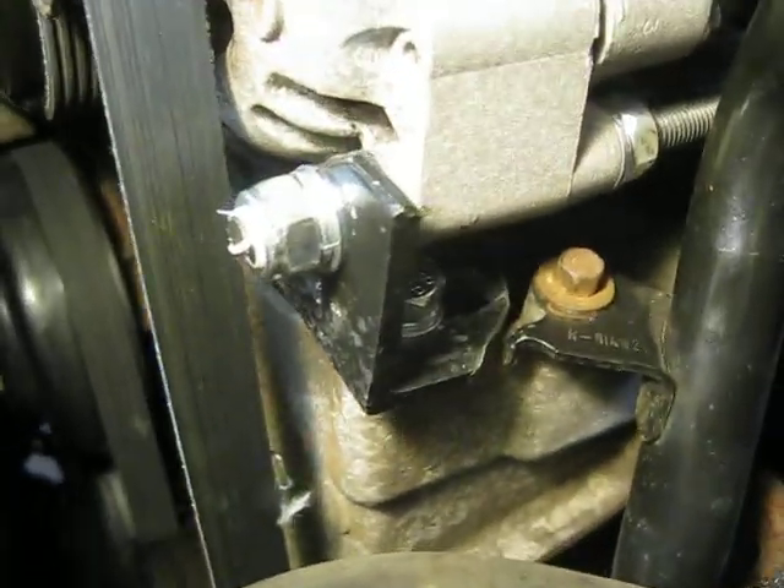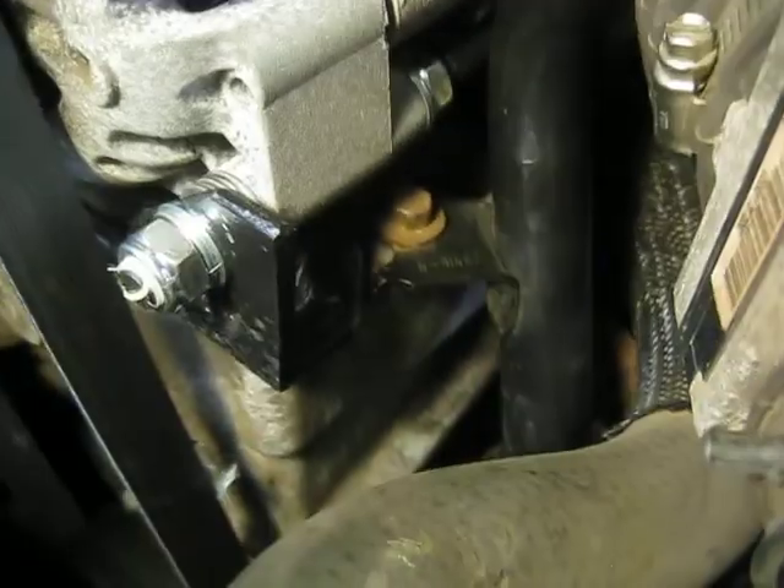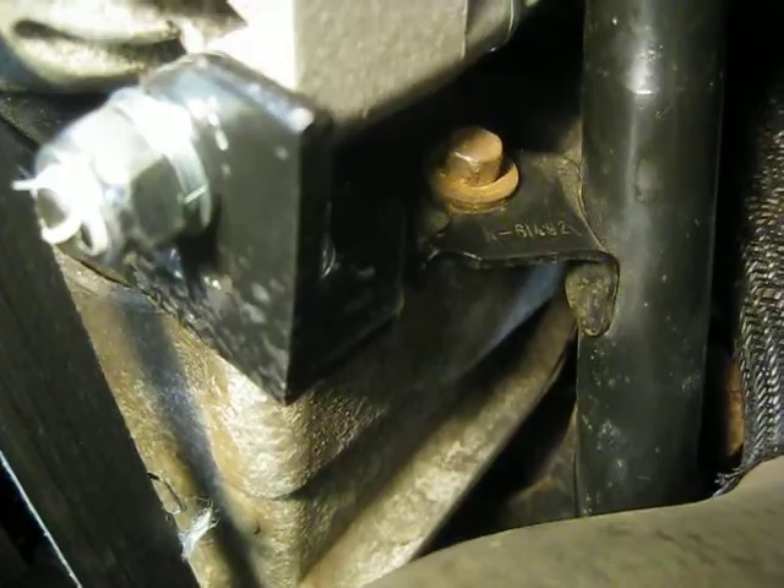Here's a little video of the dual alt mount. You can see the angle where it's bolted on. You can go all the way through and you might have to remove the filler stem — that 10 millimeter bolt that just pulls out to get that tightened. The bolts are exactly the same width for the alt mount and where it bolts on where the AC was.